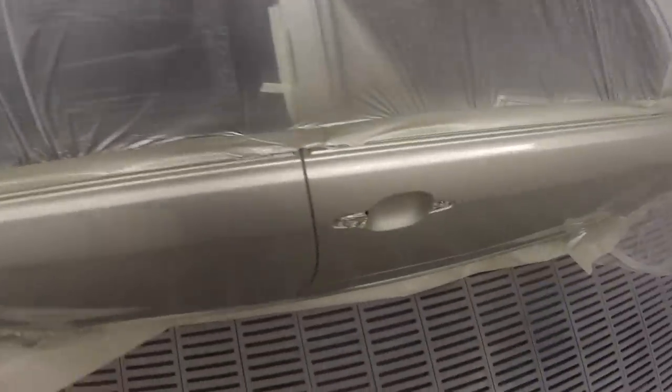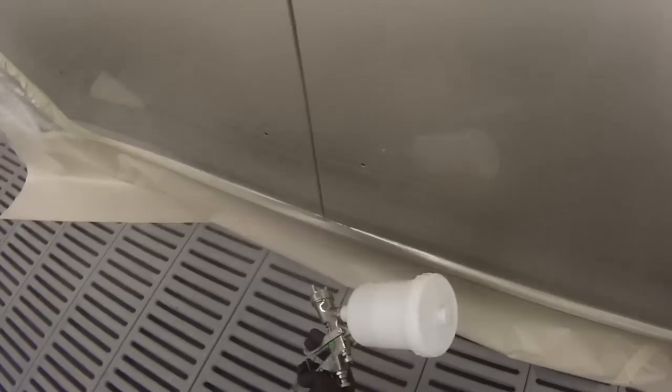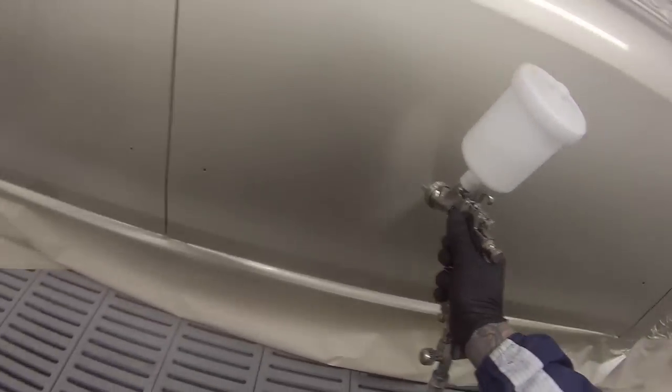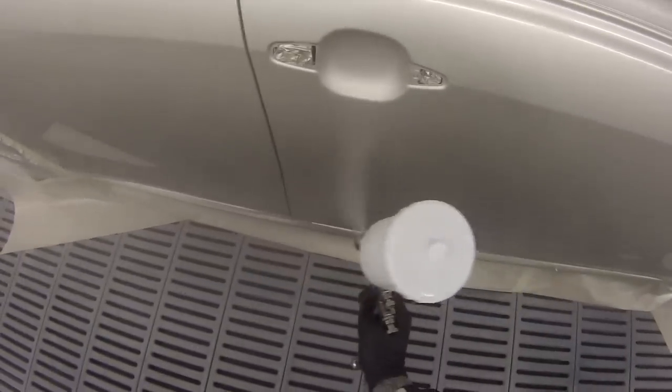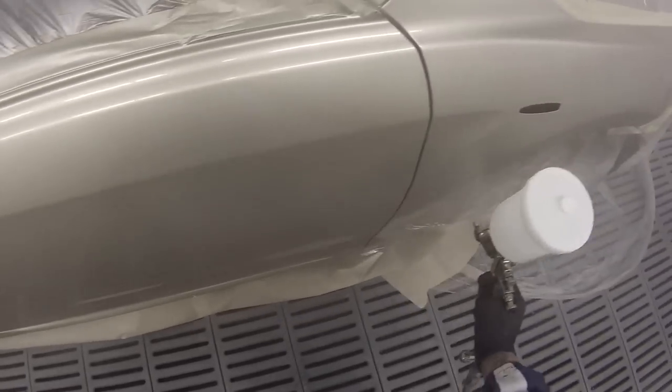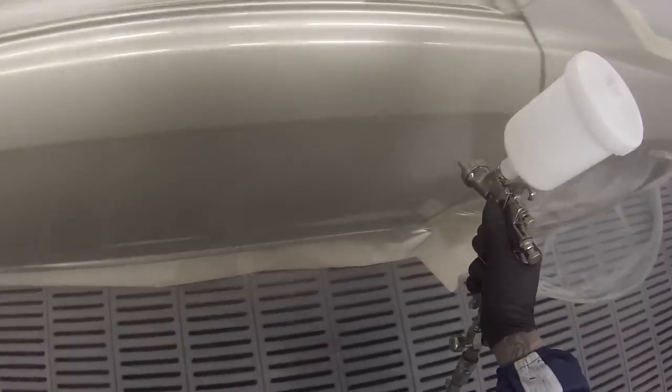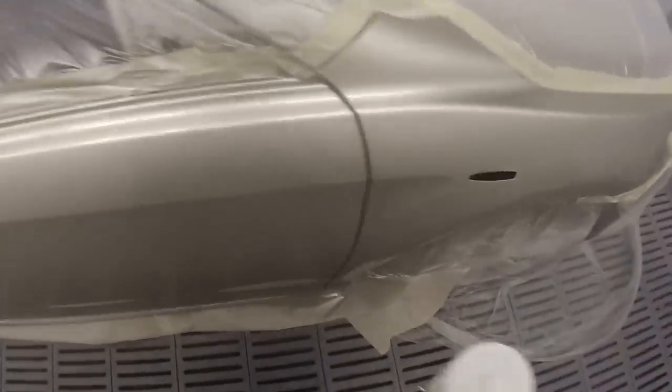The gun itself is the same shape as the classic W400s — a pretty good looking gun with a nice chrome body and a nice feel in the hand. Take note of the technique I'm using here: a slight flick out on the edges. I've also painted through those door gaps. If you paint right up to the door gap you can end up doubling over and getting a big thick build-up of clear coat on those edges, so I use a wrist flick at the edges to avoid that build-up.